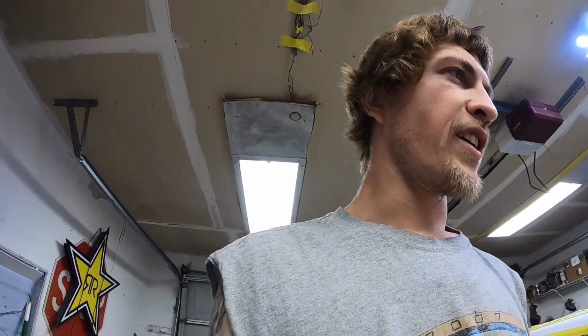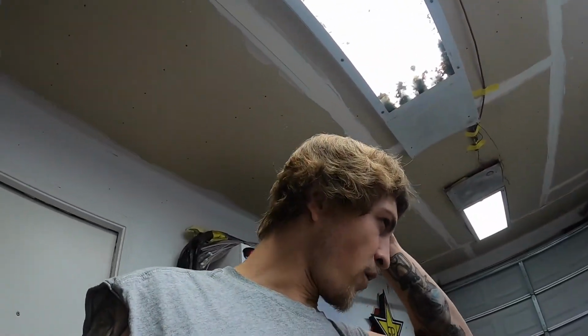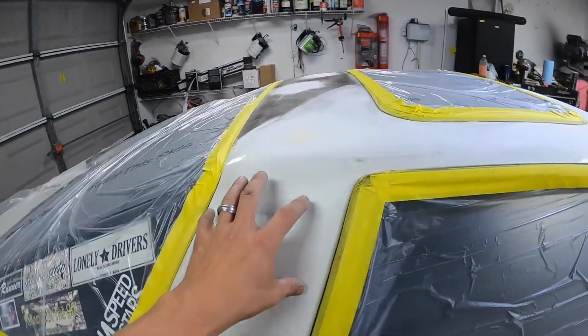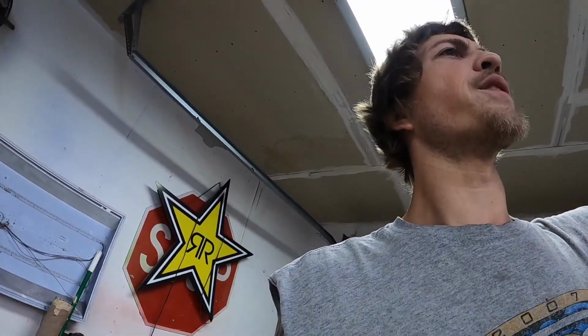So right now I'm gonna go ahead, make up some primer, and shoot all these spots that we have. I think there was like, don't hold me to it, but I think there was like 40 something Bondo spots, and then there was 9 PDR spots that I was able to get out that didn't need anything. There was a couple in these spots here on both sides, and those ones kind of pulled. I don't know if they were hail dents or what they were, but I was able to get those ones pulled. A couple on the roof, and then a few on that driver's side.